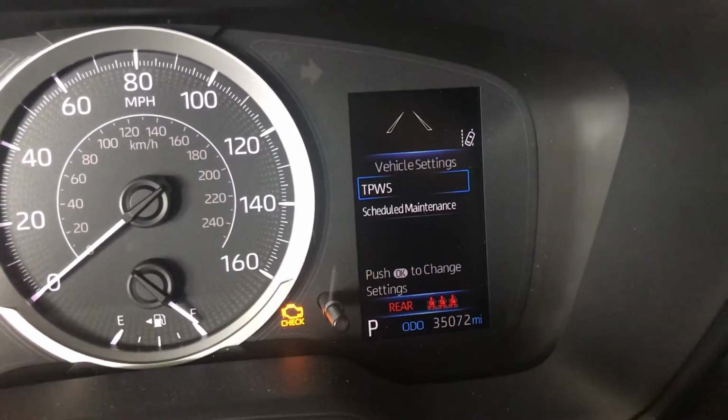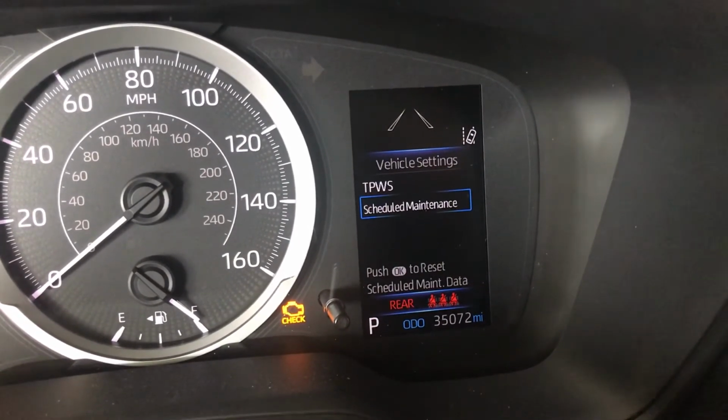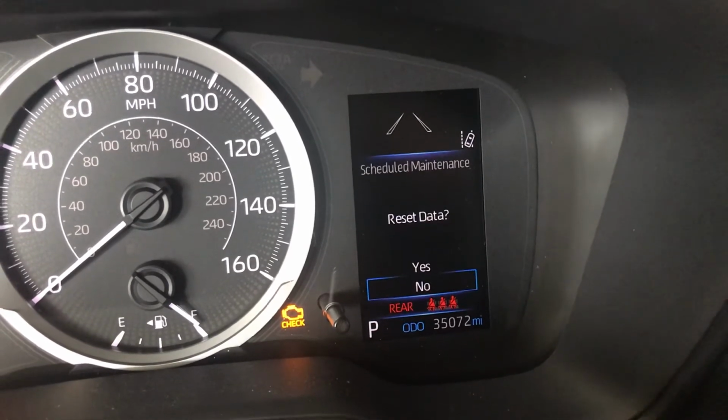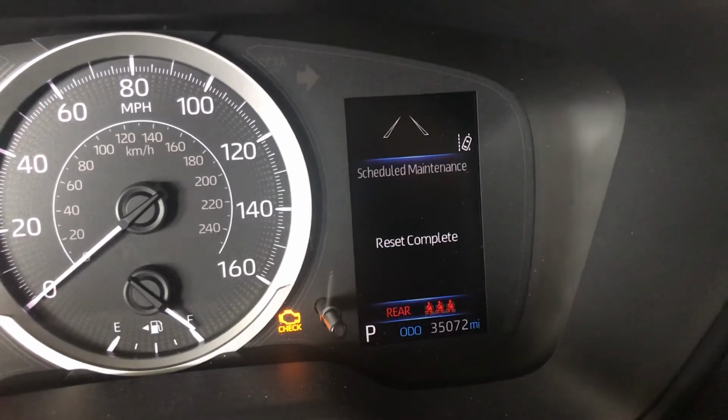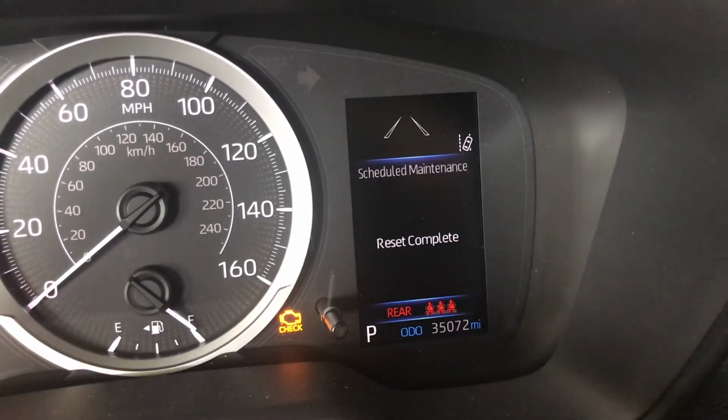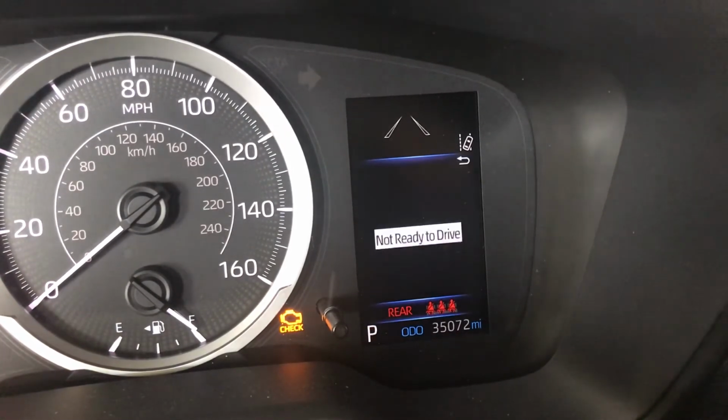Okay, now when you get here, you scroll down to schedule maintenance, enter on it, scroll up to yes, enter on yes, and the reset is complete, guys. That's how we do it.